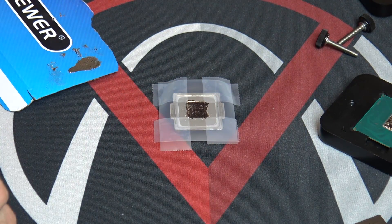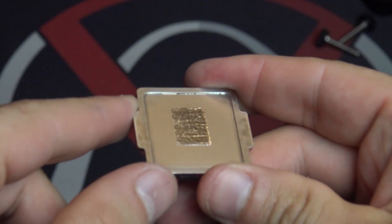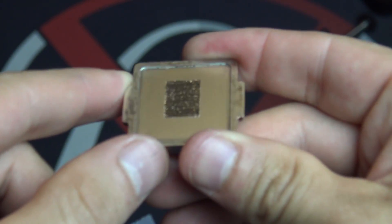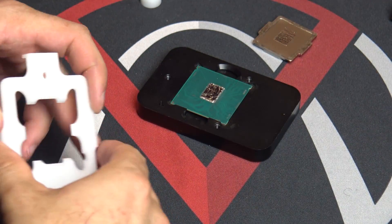Once you've managed all your measurements and applied a thin layer of the thermal interface to the underside of the heat spreader, you can simply pull away the tape and you should see a nice little mirror image of the processor die on the underside of the heat spreader.